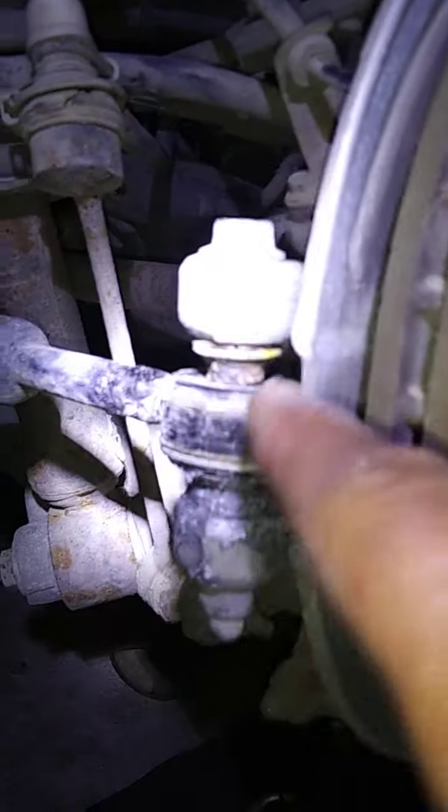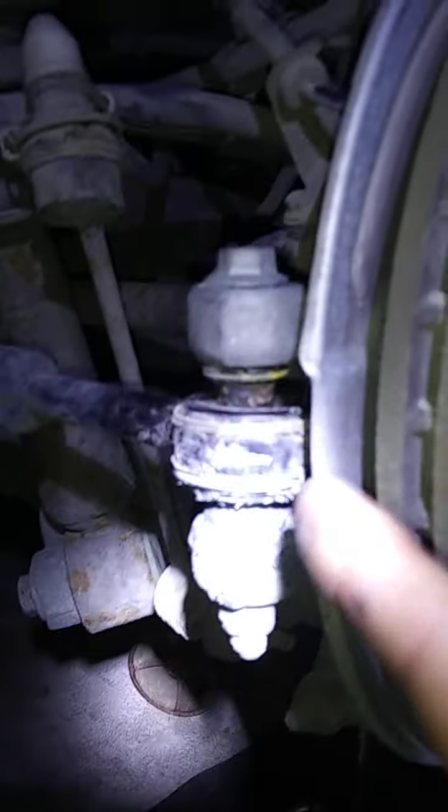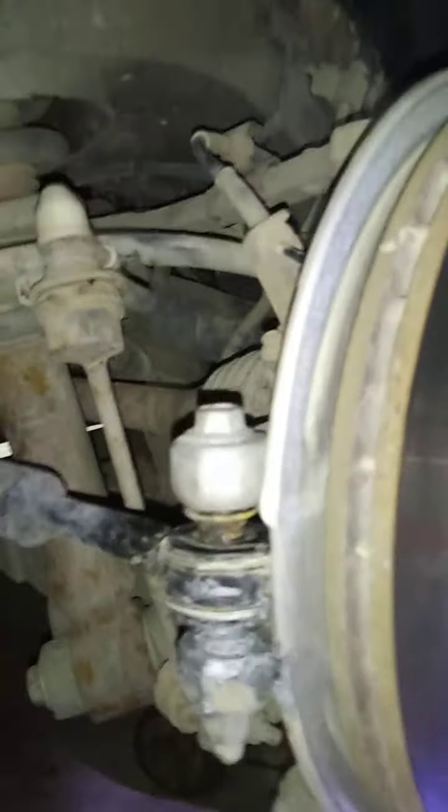I'm putting it there, okay? Here comes a neat, tricky part. You see how it was shiny? You remember under here, back the video up, it was shiny. Look at it, it's rusty in here. But it's in the rubber, but there's a bushing. The whole bushing goes all the way through. One bolt. It doesn't pivot. It has rubber all here. The rubber is all here, with a bushing in it. It's not a ball joint, but same difference. This is a $250 part. If you took it to a dealership and had them align it and fix that, you're talking $500 if it goes bad. All right, now here's what I'm going to do on here.